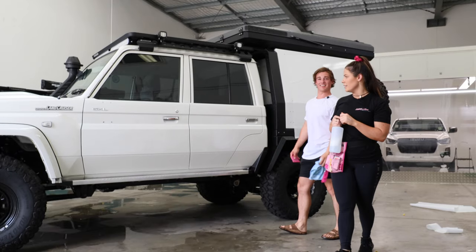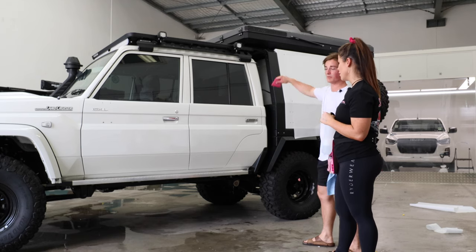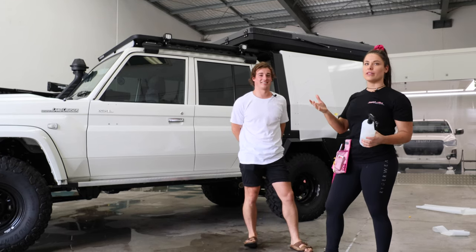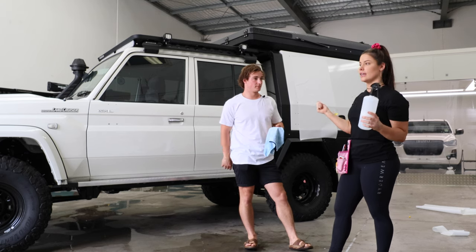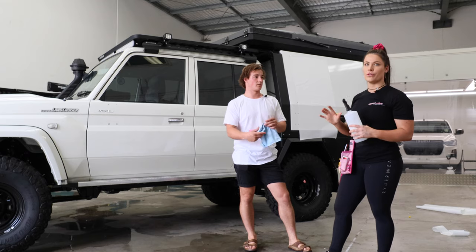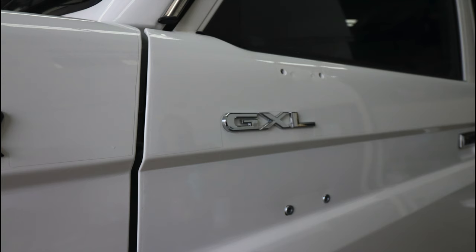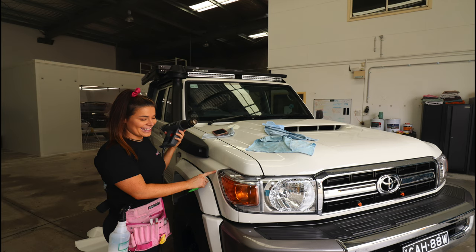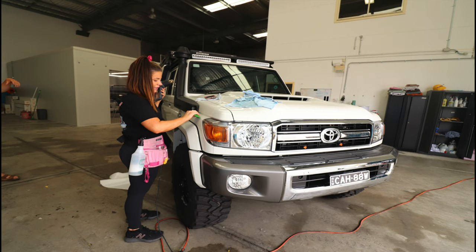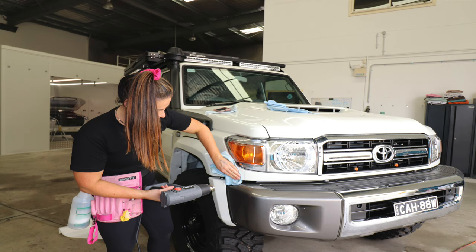Look at that beautiful gloss finish. Was that harder or easier than you thought? That was easier - once you get in the rhythm of things, once I've done that one panel, I'll be fine with the next. That's exactly why you get your test panel to warm up. I always recommend that you start on a door first because generally they're the flattest panel. If you had a big tub size, that's a lot of material to handle. So don't start on the harder panels - start on a door, get a feel for it, do the four doors, and then by the time you get to the fenders or the tub, it will be a breeze. We'd like to thank Matty and her team at Slickaz. As you can see from my experience installing the Bush Wraps DIY protective film, it is super easy to install and absolutely anyone can do this job with a second pair of hands. Jump onto the Bush Wraps website and check out your kit for your vehicle. Cheers guys, thanks for watching - hit the subscribe button and drop a comment below.